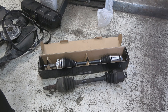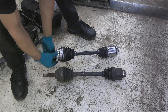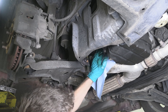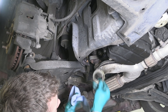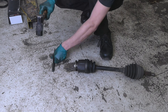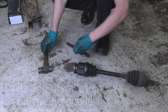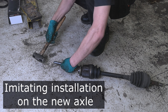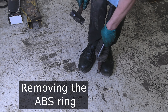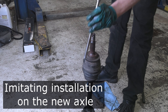Compare it to the new one, make sure they look the same and are the same size. Looks like I am missing this dust shield. Let's clean the area — there is the old dust shield. If the new axle came without the dust shield or the ABS ring, make sure to transfer them over to the new axle. Be careful not to damage the teeth on the ABS ring, because it can affect the ABS reading. Use dull objects and rubber mallets to transfer it over.